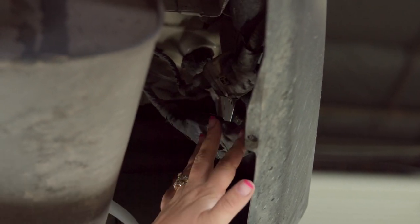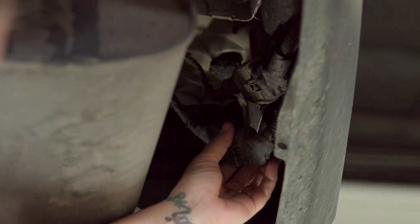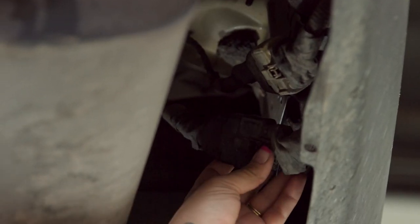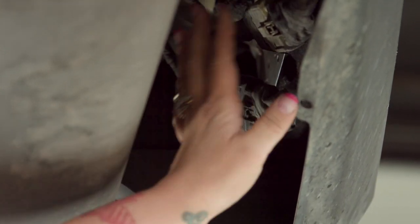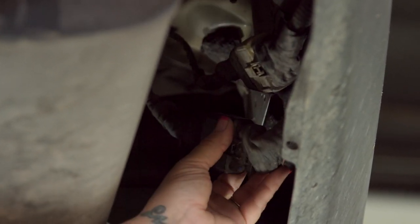Once you've located the two wiring harnesses on the passenger side of the vehicle, you'll see that there is one that hangs lower than the other and it is all black versus the cream color. We're going to use the lower portion. They're identical, but if you take the other one apart it won't work, so it's always the one that's going to hang lower.